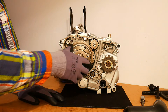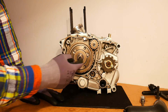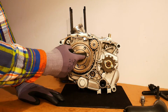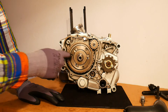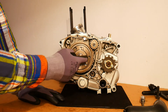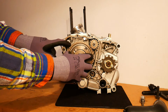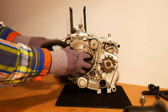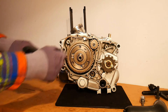Here are the three rollers. This driven gear is driven by the starter motor. This section in the middle between the rotor and the starter clutch is actually part of the driven gear. The starter clutch can rotate independently of the driven gear because the rollers move to the right hand side - they don't grip the driven gear. Now if I rotate the driven gear, all of a sudden the little rollers move slightly. As you can see, this one has moved to the left hand side and it grips the driven gear. That friction between the roller, the driven gear and the starter clutch causes the starter clutch to rotate with the driven gear.